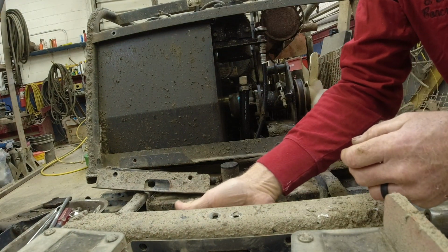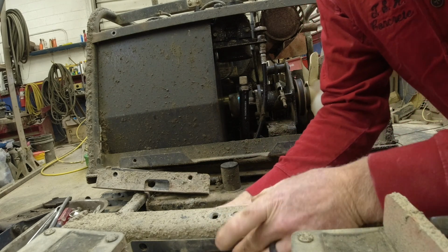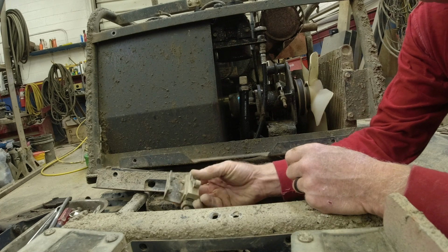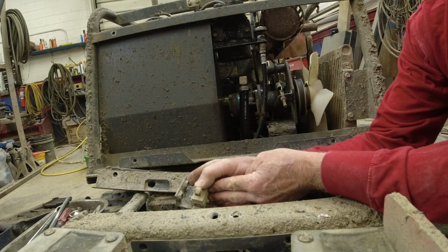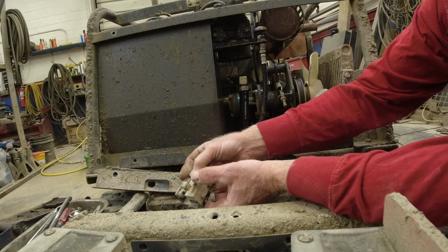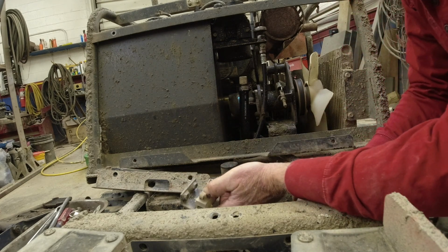So, as I took those out, the switch dropped out. Here's the plug. Let me just wiggle this out and bring it on up. So you can see it's just on a little bracket. I can undo those screws. If I could just change this wheel, the switch is still good. You can hear it working in there. So if I couldn't get this switch, I was just going to wire tie that shut. That's a closed switch, that's open switch. Close it and do without it. Since I can get the switch, like I said, we always want to put it back the way it's supposed to be.